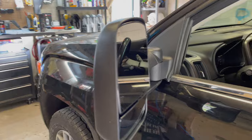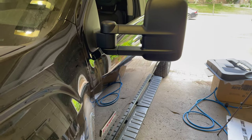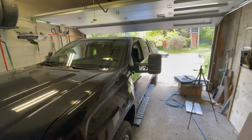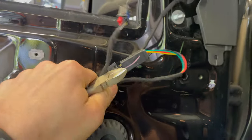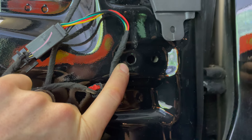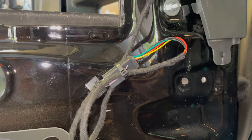Driver's side mirror is on. It's not bad — you really can't notice it from four or five feet away. Obviously if you're looking for it you can see it, but it's a significant improvement. The mirrors don't look out of place; they're just funny how low they sit compared to HD trucks. Quick watch-out with the excess cable they provide: just zip-tie it up and make sure it is not laying over the locator hole for the door card. Get rid of the excess cable and you're good.